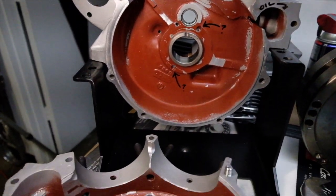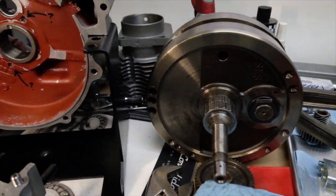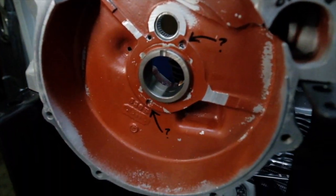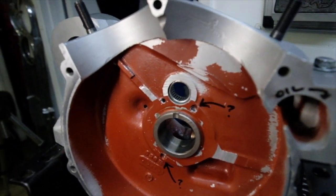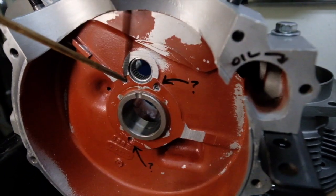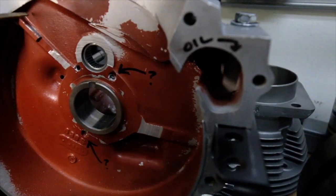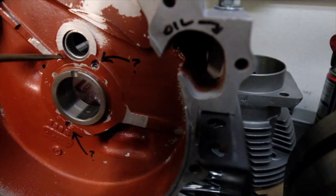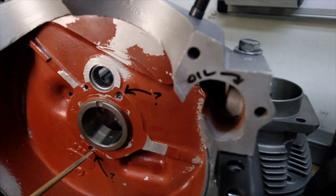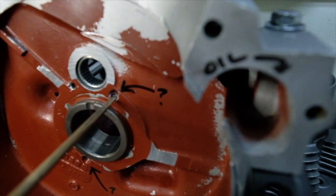I'm cleaning these cases lightly one last time, getting ready for the installation of the crankshaft. It's a good chance to have one last look inside the crankcase and point out a few features. This raised ridge here acts as a guide for oil to go into that port there - that port actually connects to the bearing race. There's a hole in the bearing race so as oil comes down the wall, it goes into that hole and helps lubricate that bearing.